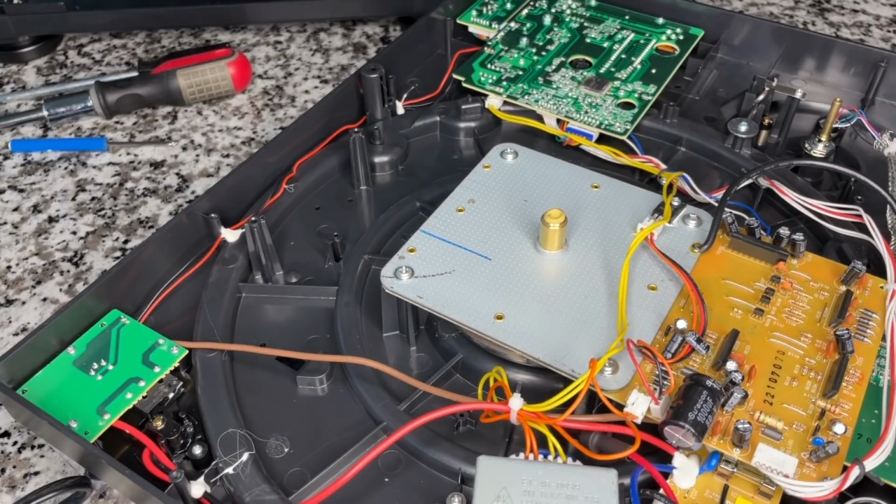Here's another thing I want to mention too about direct drive versus belt drive. A belt drive turntable motor is going to spin at hundreds of revolutions per minute, and through gearing is slowed down to 33. I shouldn't say it's slowed down, but the affected platter rotation is slowed down. So there's a lot more cogging that happens in that cycle per second versus a direct drive, which spins at 33 or 45 RPM instead of 1200. So there's something to take into account there as well.